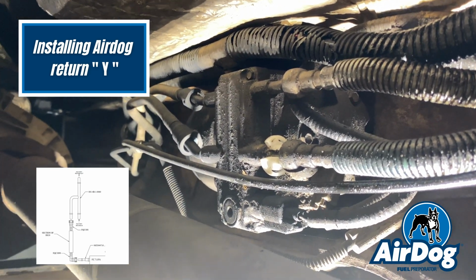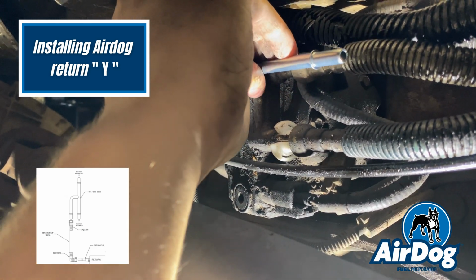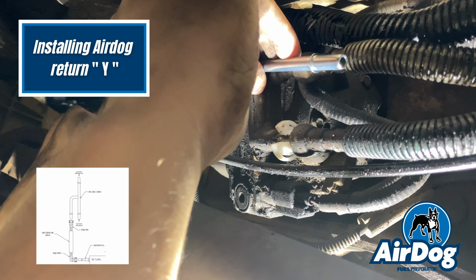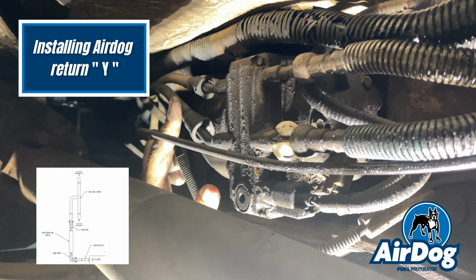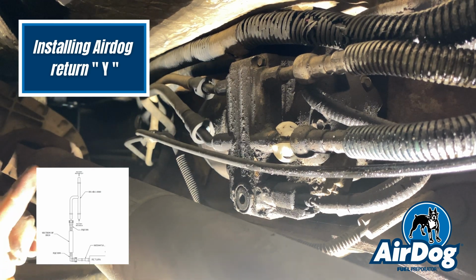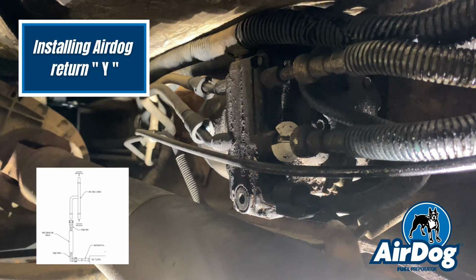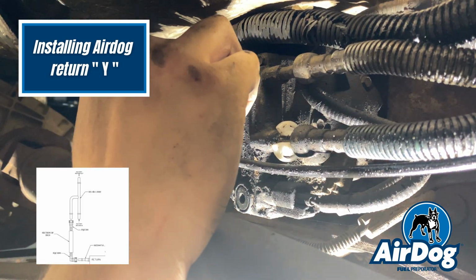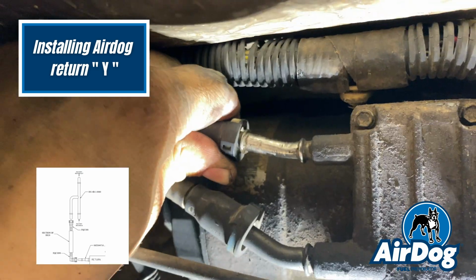So you're going to be like this. The return Y is going to tie those two factory lines together. This is going to allow for the Airdog return to tie back in, and this is no longer used, as this is the hose that was connected to the top of the tank. So we're going to get these 3 lines popped off. We're going to pop these 2 electrical connectors off to verify that this pump doesn't have power after we remove the fuel lines, and then we'll make those other 2 lines.